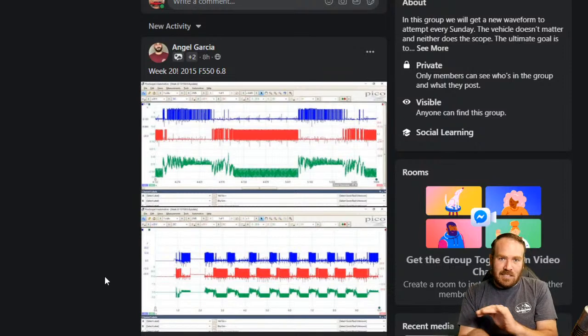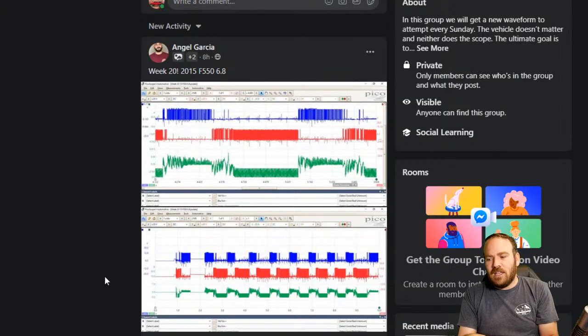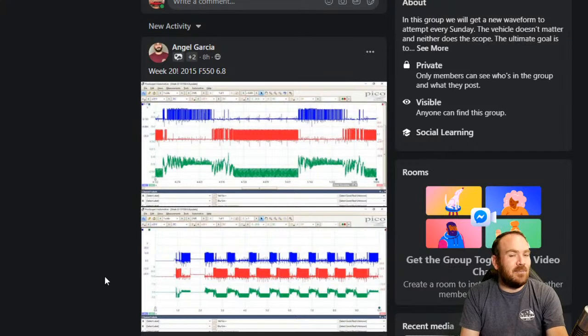If we press the gas pedal, it's still going to remain at zero. The computer's not going to acknowledge that input from the accelerator pedal. Some vehicles, if we unplug it, might go up to 5 volts. Well, then the computer's going to think that we're wide open throttle. It may try dumping a bunch of fuel. It's not going to know what's going on.